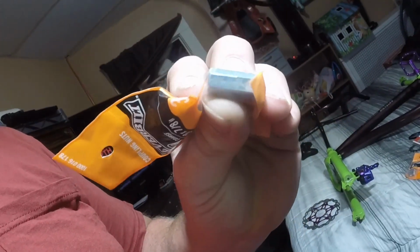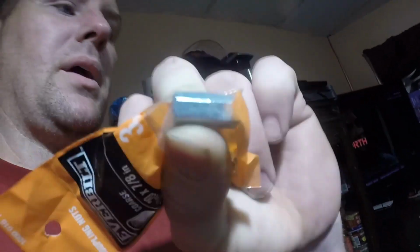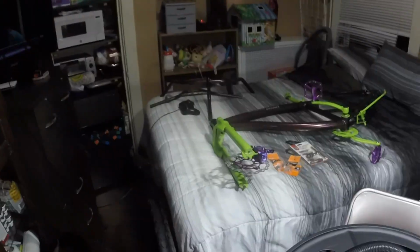What I got for spacers are these. These are collets, right? They're a coupling nut. I'm calling them collets, whatever. For all thread, you put this on one end, and then the other piece of all thread goes into it, and you connect two pieces of all thread, and boom, you have one big long piece of thread. What I'm going to do is drill them out. These are mild steel, but that's okay. They are 21 or 22 millimeters when I measured them, so they're a little bit big, so that's perfect. I can grind them down to what I need, and then boom, I have a nice rotor ready to go. So that's just the front wheel.